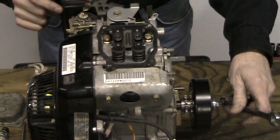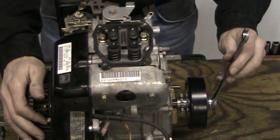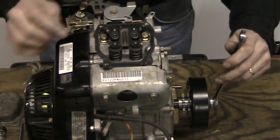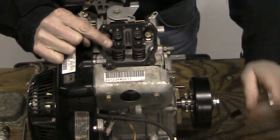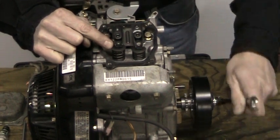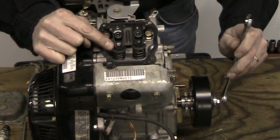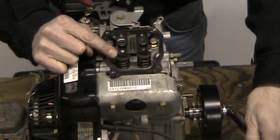You'll take a half inch wrench and hook it to the bolt on your clutch. All three engines will be done the same way. You want to rotate the engine in the direction of rotation — that's the direction the clutch turns when the sled is moving forward. You'll watch this rocker arm carefully because it is our intake rocker arm. You'll continue to roll your crankshaft over with your wrench on the clutch, and sometimes you'll have to go several revolutions. Now you're going to start to see the intake rocker arm open the valve.